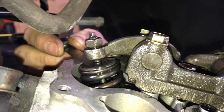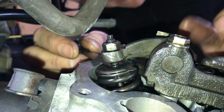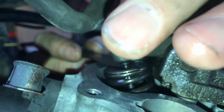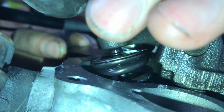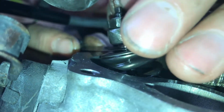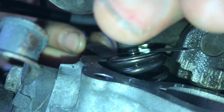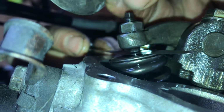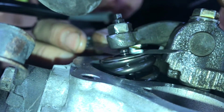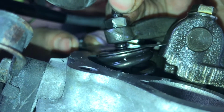still loose. So what you have to do is slacken off the lock nut, not quite that much, I just did that to show you. And then you can turn this, there's a square head on there which you can usually just turn by hand. So I'm tightening that down until we've got a sort of sliding fit, so I can still slide it through, but it does pinch a bit, so there's a little bit of resistance as you're sliding it, so that's about there. I can still move it, but it's pinching it.